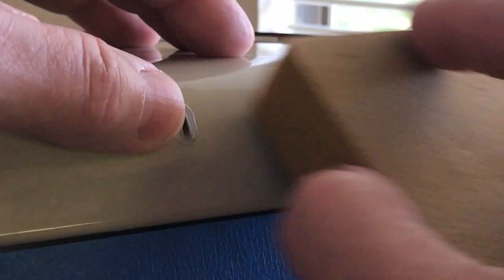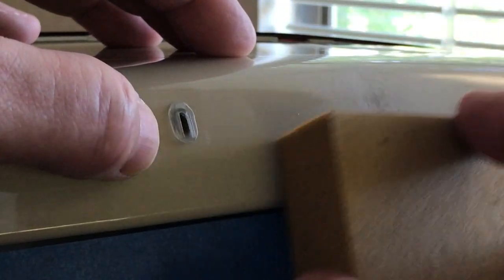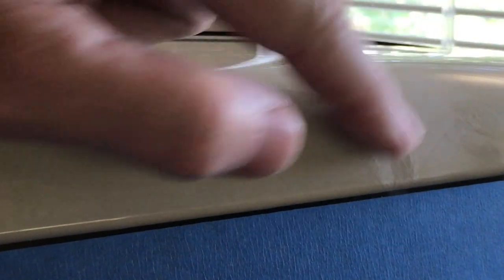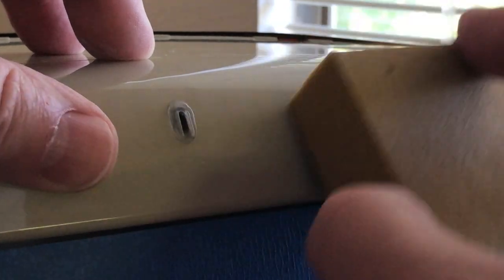We're dry. I'm just going to very lightly go over this — all I'm doing is knocking down the rough spots, not putting very much pressure at all. Yeah, it's going to look ugly before it looks better. We could always polish it up with some Meguiar's — that's what I use to polish up a lot of covers, a plastic polish. That stuff works fantastic. See, that's dull where I sanded it, but if I go over it with some real fine paper, like thousand grit, it'll polish up.